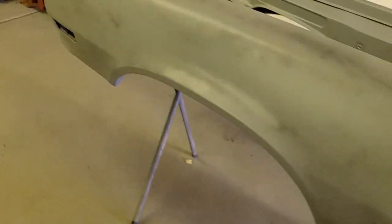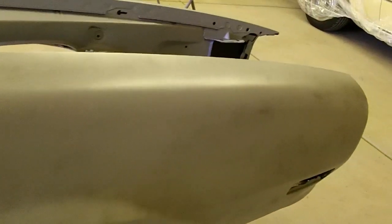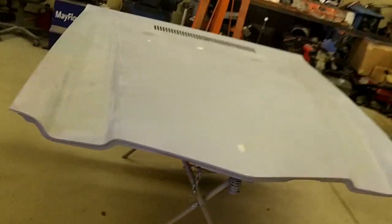The roof looks pretty good — I kind of went over it lightly. All of this work had been done by my father-in-law when he owned the car, so until I get another coat of primer on it I won't really know where it's at, but I don't suspect there's too awful much. I got the fenders in primer — I removed all the crappy primer that was on this left fender. This is the original driver's fender and I epoxied it and then went over it with a couple coats of 2K. The passenger-side fender was off that '72 RS and it's a real nice fender — I fixed a couple little areas and reprimed it. I also went ahead and coated the backsides of both fenders while I had them off.